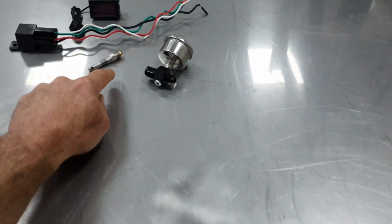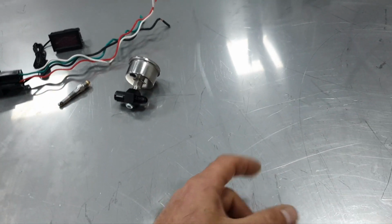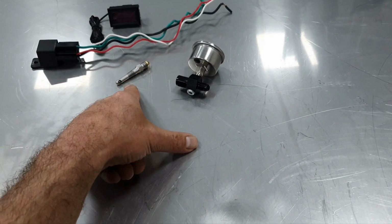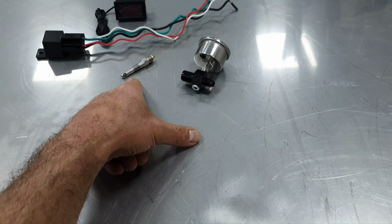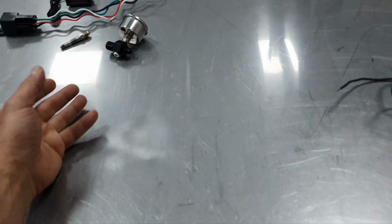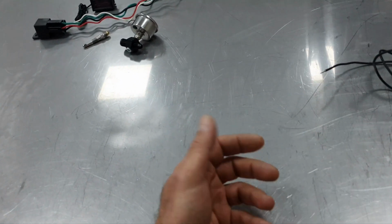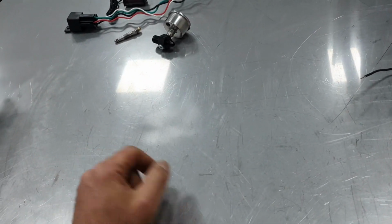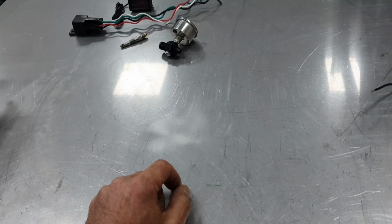I need to fix also the jet on the charge pipe. Because it's a turbocharger application, I'd like it to be far away from the intake, and I'd like it to be against the flow. You're going to have plenty of pressure inside the bottle. I'm just saying, to have a chance to blend equally, not to be near the throttle. I might be wrong on that.